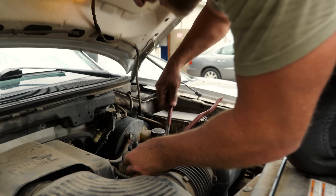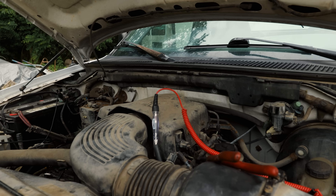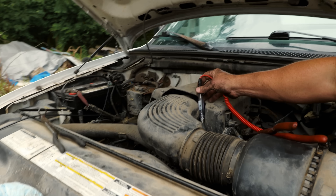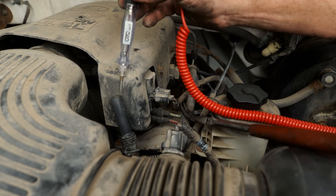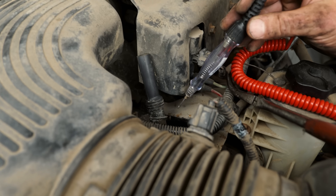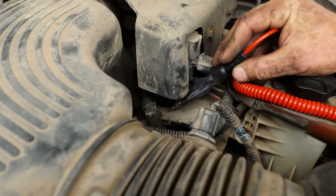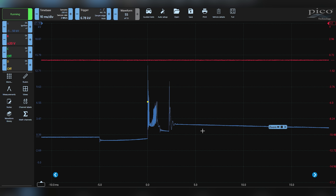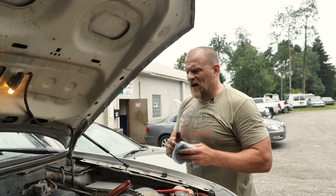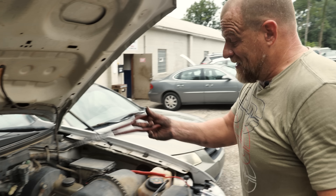Let's see if I can pull this up. Let's see what we got here. I heard some arcing from this. There you go — there's our arcing right there. How cool is that? That's what we're hearing. You saw the waviness or hash in this number five too — you can see it now that it's arcing continuously. That's a bad plug wire all day long. The number six — I'm saying plug for number six.